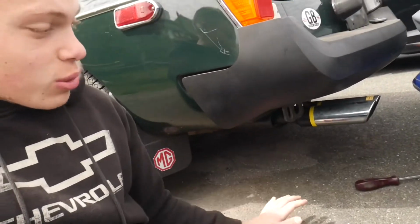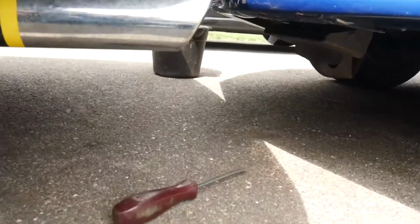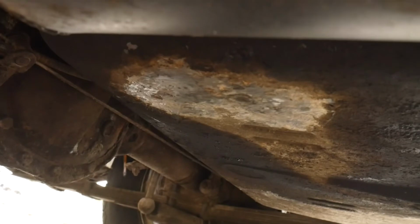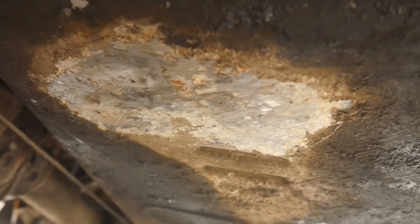So guys, we actually left off a couple days ago, like 2 days ago, because this gas tank was still draining. It was such a slow leak, but it was enough that, you know, it's obviously a problem. But it's obviously done draining now, and I just scraped away at the paint with the screwdriver because it was all bubbled up from the fuel, and the metal underneath there is actually really, really clean. So I'm actually pretty surprised, but I cannot find a hole anywhere.